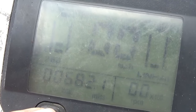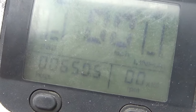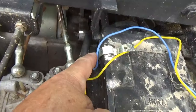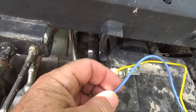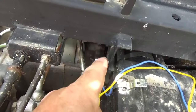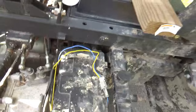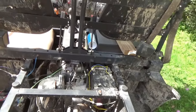You can see it's a relatively young machine — less than 700 hours, only 650 hours. This thing probably originally died of a broken wire that goes to the pulse generator that triggers the CDI. These are the wires to it. I ended up discovering it was broken right up against the pulse generator, so I just re-soldered the wire. Generally speaking, its major problems are all electrical.